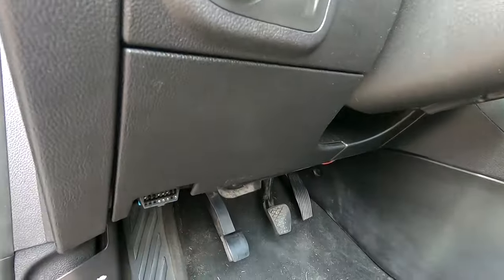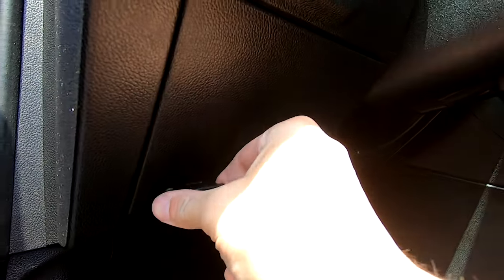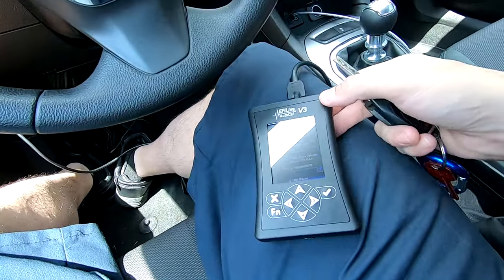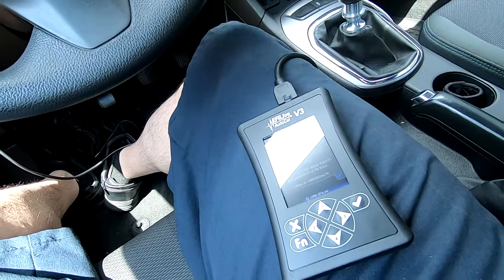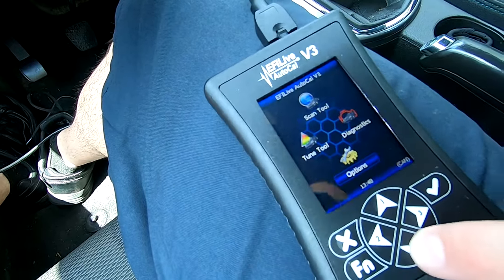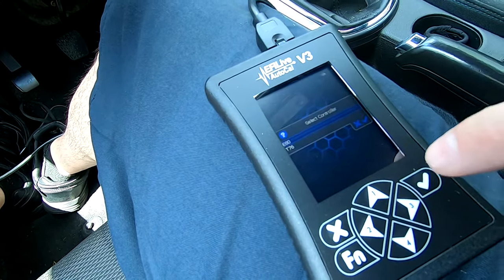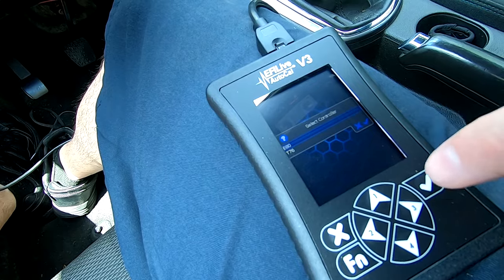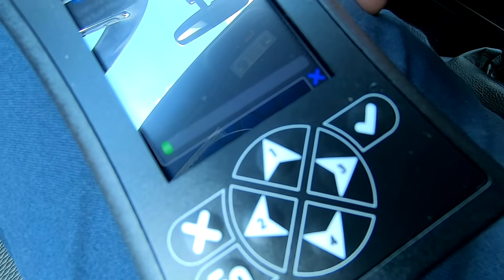Here's the next step on using the Bad News Racing AutoCal. You have to tap into the OBD2 port — take this and put it right in here, then turn your key on but do not start the engine. I probably should not have picked a 90-degree day to do this, but here you go — you see the AutoCal working. Pick tune tool, pick the check mark, it says tuning, pick the check mark and then read tune. Make sure it says — at least on my car it's E80. Your car might have a different number but it has to start with an E. Now it looks like it's starting to read everything; that green line is telling you how much of the tune it's read.